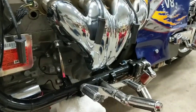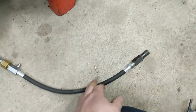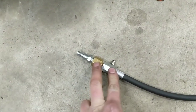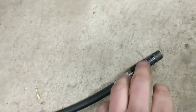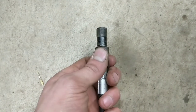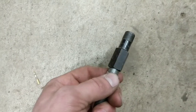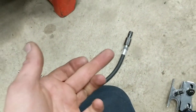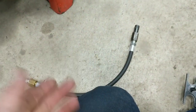Now we're going to move on to doing the valve springs. I have this tool - it's actually the bottom half of a compression test gauge, with a 1/8-NPT adapter to 1/8 to 1/4, and then our air hose fitting on this side. Down here underneath is the correct spark plug thread adapter with a Schrader valve in it. We have to remove the Schrader valve because we have to make sure we can put air in it essentially the wrong direction. If your compression test gauge doesn't let you do that, you're going to have to find one that does.